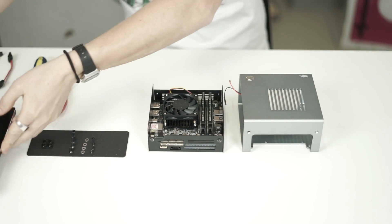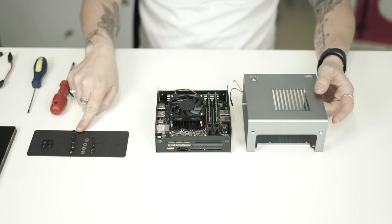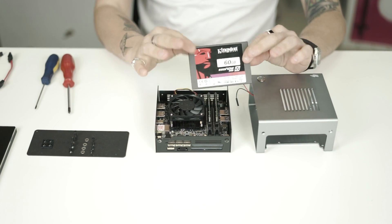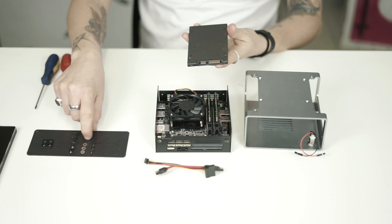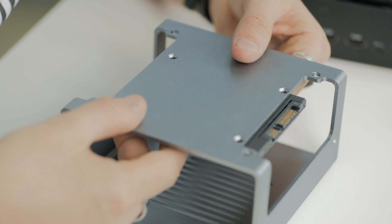But if you need to use an external hard drive or install the case on a monitor, we are covered! Keep in mind that you must fix it without the inner part inserted. The big flat head screws are for the VESA mount. The other flat head screws and washer are for the hard drive — first place the washer, then center the hard drive, and lastly fix it with the screws.